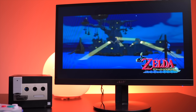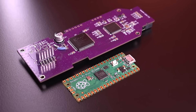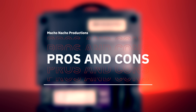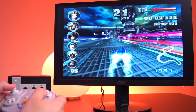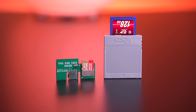I'm super excited to see the final version once it's released. So while this project has come a long way, there is still plenty of work that WebHDX has to do to convert it over from using a CPLD chip to a Raspberry Pi Pico. Now let's talk about some of the pros and cons of the device. Starting with the pros, obviously the first is the increased performance and data throughput we get from the M.2 Loader. This offers several benefits such as better playback of FMVs, reduced audio glitching, and in some cases better compatibility with games that previously had issues when loaded with an SD Gecko or SD to SP2 adapter.